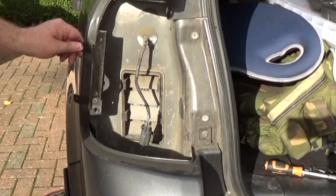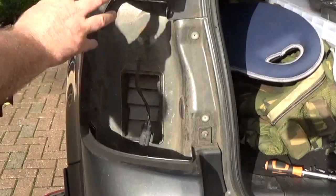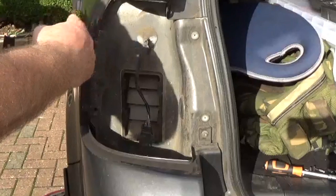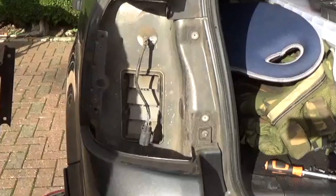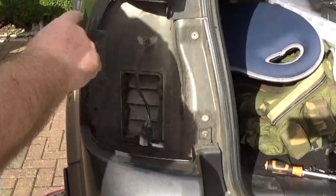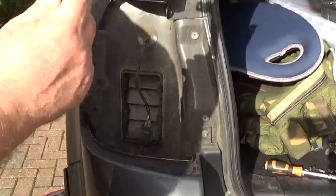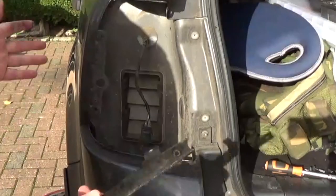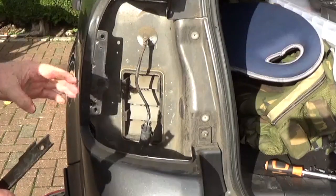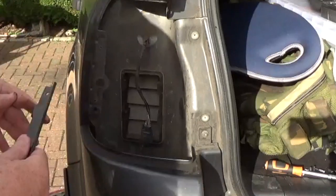It doesn't matter what year you have, the light clusters will fit the same way. The light bars only really work with the older rear lights, with the full circle at the top and then the partial circle lower down. The later type that have the full circle lower just isn't going to work, because the light guard's going to go across the indicators or reverse lights. And the very late LED type ones, I don't think it works very well either. So year-wise, you're probably looking up to about 2010, 2011. Any later than that, I don't think the light guard's going to work.